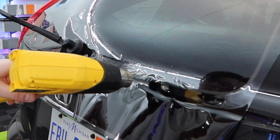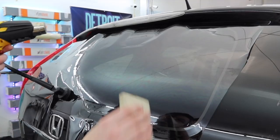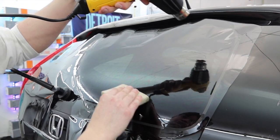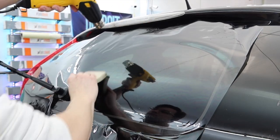Right at the bottom, you can get the heat gun much closer because there's so much more film that needs to be pushed together. Right when you get past the glass edge line, you're home free. With the top, it just moves a hell of a lot faster. With that extra film that we had bunched up there, it really doesn't equal the same amount of film as the bottom.